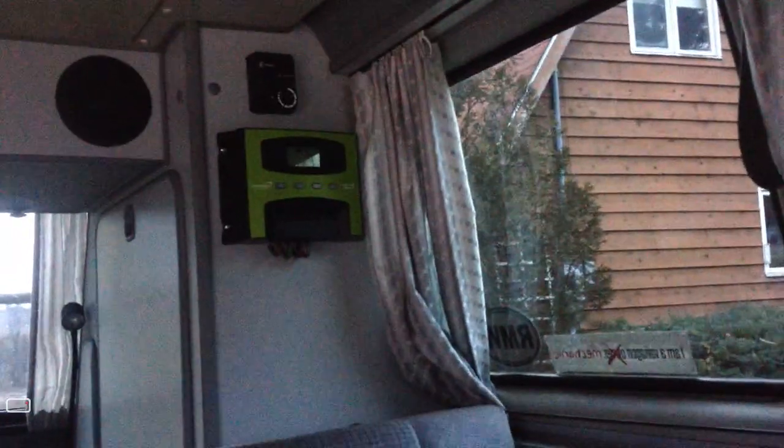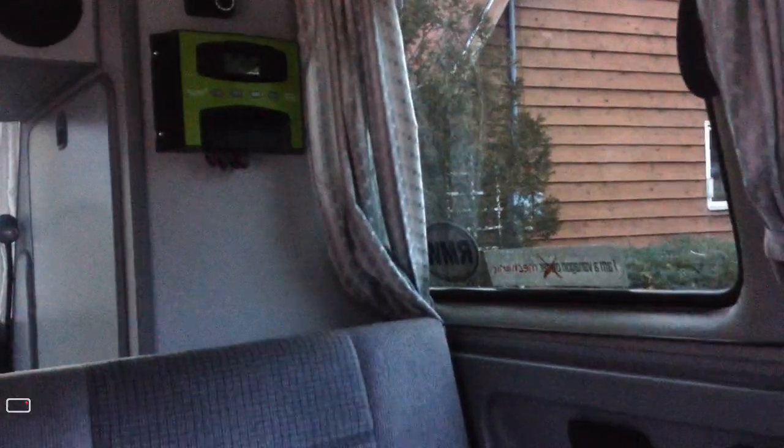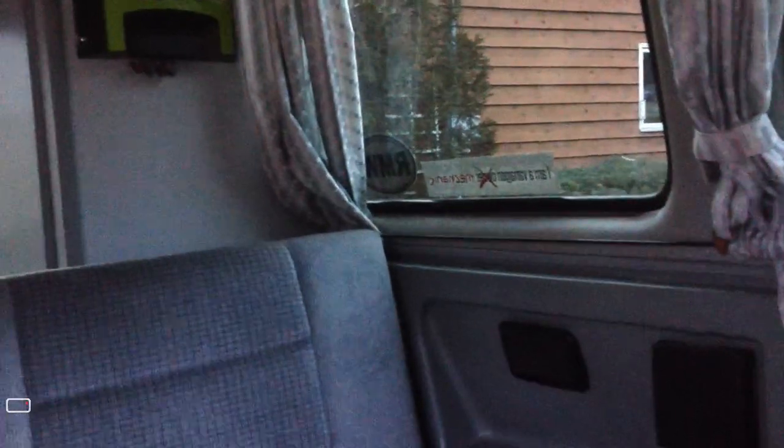There's the Propex thermostat and our ProVista MPPT controller, which works spectacularly. I've got 100 watts of solar on the roof — in full sun I get somewhere just short of 6 amps of current, which is plenty to keep four batteries charged. I've got four 45-amp-hour batteries on board: one under the driver's seat, one under the back seat, and one in each corner behind each taillight. It balances the weight out nicely.